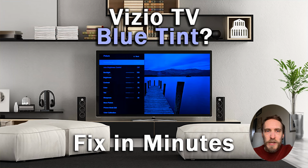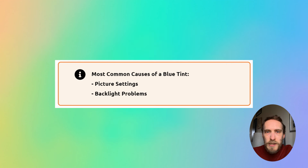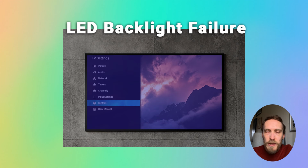If you've got a blue tint on your Vizio TV, then there's a few possible causes which we're going to cover in this video along with the fixes for them. So the main causes of the blue tint can either be picture settings or it can be LED problems. If you've got a really strong blue tint, then it's almost certainly LED issues, which are fixable at home.